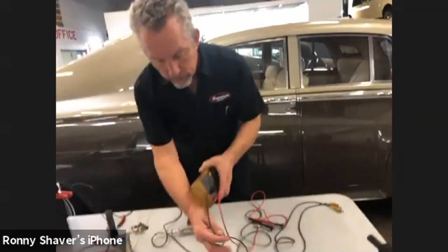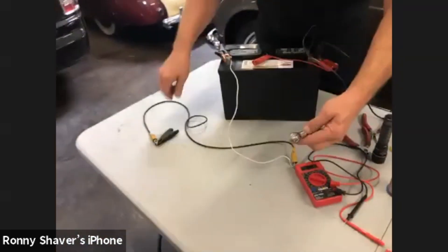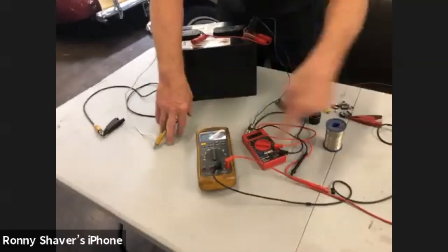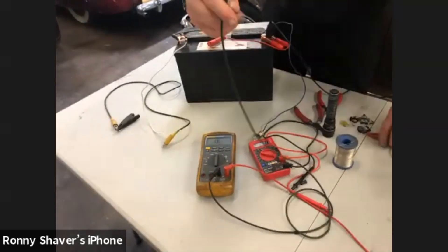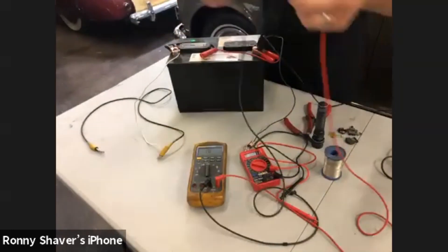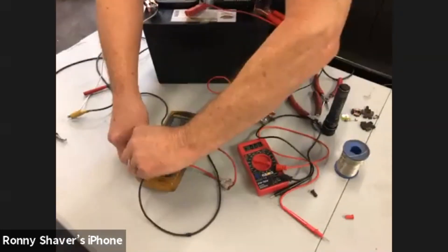This DVOM has a great feature for voltage drop and I'm still figuring out how best to demonstrate it. Let's hook up our light and try to duplicate that. That was a great question by the way — it's a very common problem. That's also why I don't like testing fuses with a DVOM; I prefer to use a test light and operate the item under load.